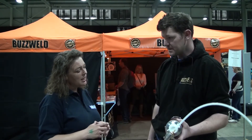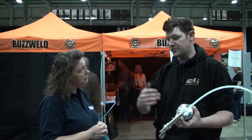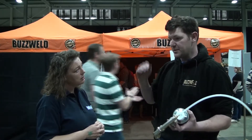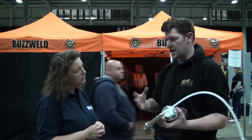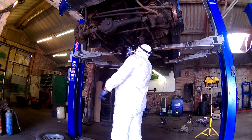When you're talking about air going through, you also do an internal chassis product — is that correct? Yes, we do a cavity paint. What you've got externally typically is your standard paints and then a corrosion stabilizer — that's kind of like using a rust killer and then a primer. Our primers, you just use the primer and it stabilizes the rust as well. We do a cavity paint that does that internally. So if you go for the highest VCI wax like Zero Prep or WAR, they will release vapor and isolate corrosion from atmosphere, but they won't stabilize corrosion that's already there. If you put the cavity paint in first, that will stabilize corrosion to a lower-reacting form so it's less likely to corrode by itself.